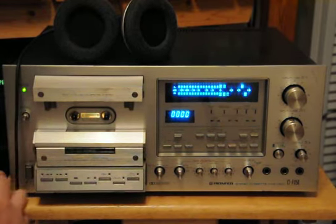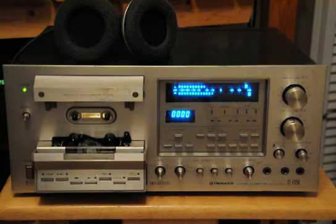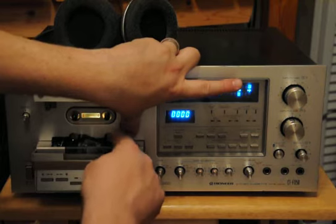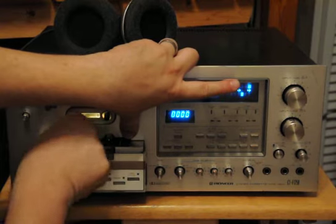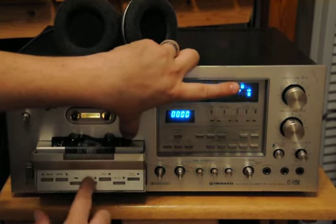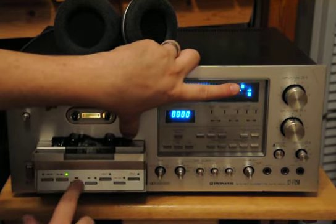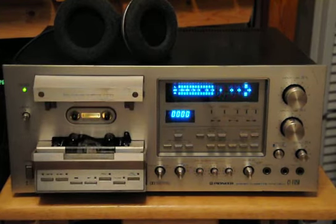That's the source. Tape path — you'll see that in the pictures. When it thinks there's a tape in there, this capstan is turning, but the one over here is not. That's the belt that I've seen with my own eyes that is for sure damaged. The head moves up rather snappy though. When I try the transport functions, they try to engage, but that missing belt obviously makes a huge difference.